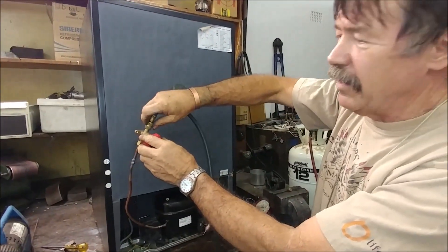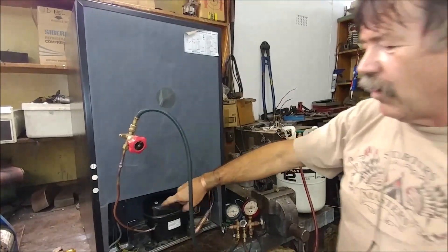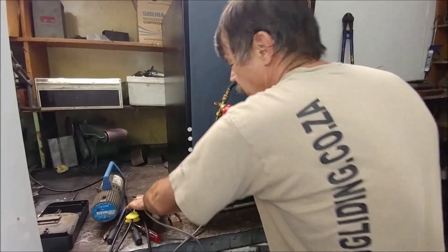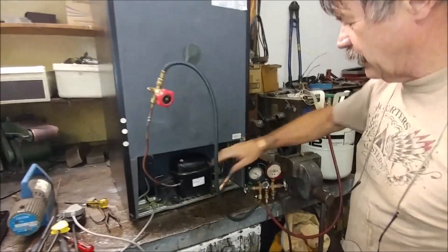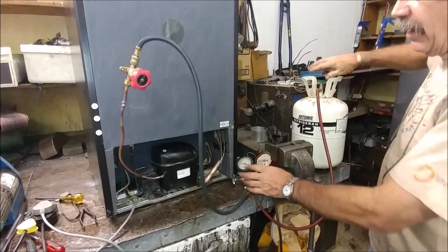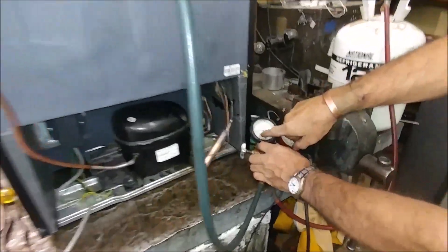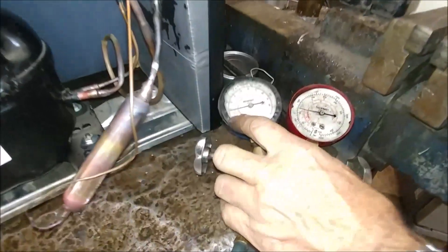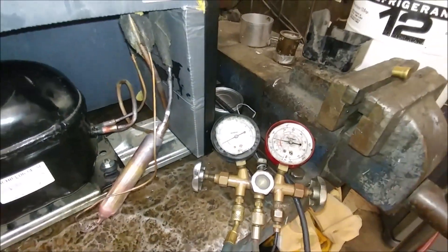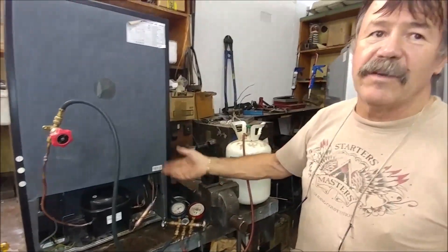Just a second like that, then we open it and the gas will freely flow into the compressor. Once the gas flows in we can start the compressor up — compressor is running. We close the bottle. Now this fridge is warm and we get it to settle on about 10 psi on my gauge — still going down. You get it to 10 psi and you're 90 percent sure you've got the right amount of gas in there, but we'll run it and might add a little bit or blow a little bit off.